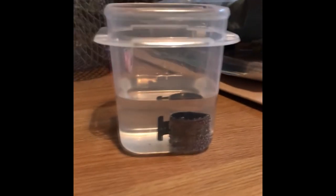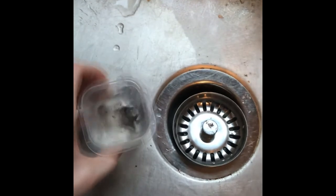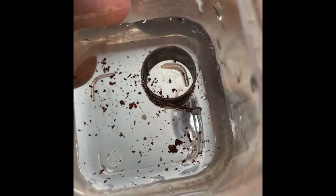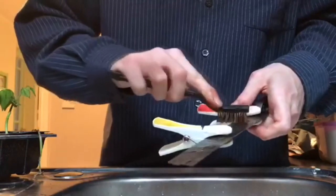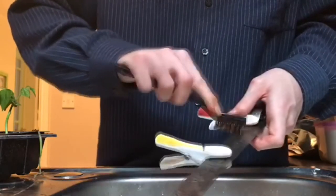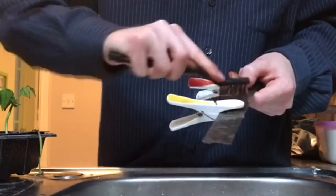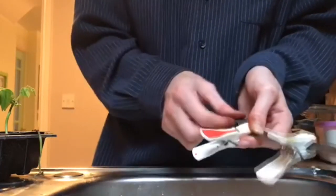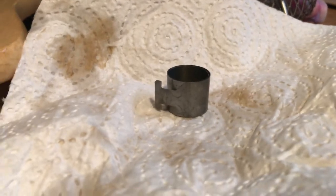After cleaning the plastic pieces, I put together a little vinegar solution and dropped the spring in, letting it sit for about 30 minutes. Then I gave it a little jiggle, and flakes of rust were coming off, indicating it's actually working. After that, I needed to stretch it out and put it on something long and flat. I used a metal rule and two really strong pegs, then a wire brush to gently scrape away any remaining rust — because when the spring coils up pretty tight, there'll still be rust left in those coiled parts. Once I'd finished cleaning the spring and dried it off, I gave it a little douse in WD-40 just to protect it from rusting again in the future.